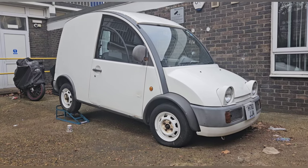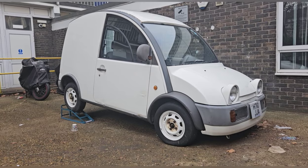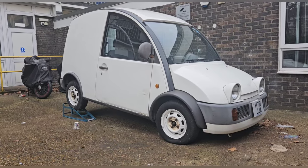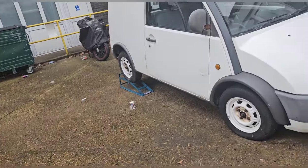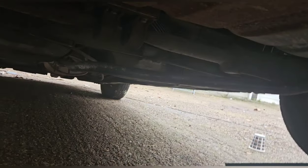I'm going to have a good look around — any areas that look like they've got surface rust I'll be cleaning. I want to use something, probably a black Hammerite, to give it some protection. I'll get some filming done if I can. Structurally it's pretty good. The seals are good — I can see the seals are good. Straight away it looks pretty solid. I think this is the fuel tank — definitely got surface rust. I would consider Hammerite-ing that, but that is surface rust. I'm actually going to clean that off with a scotch pad so that it's really clear it is surface rust.